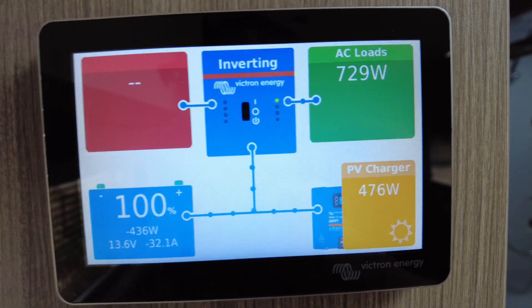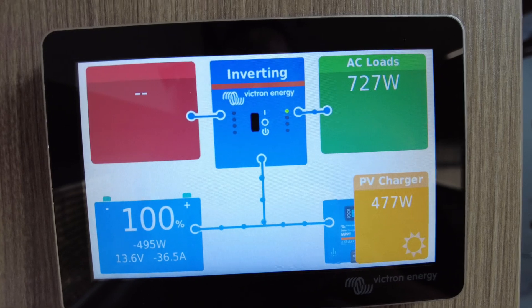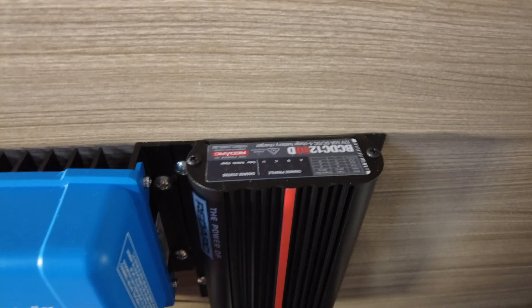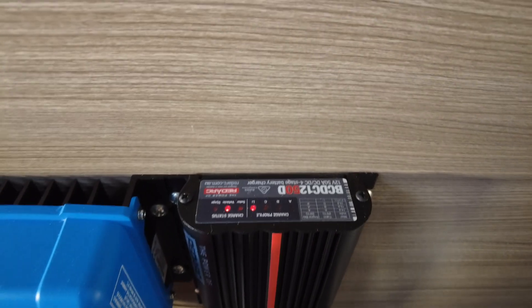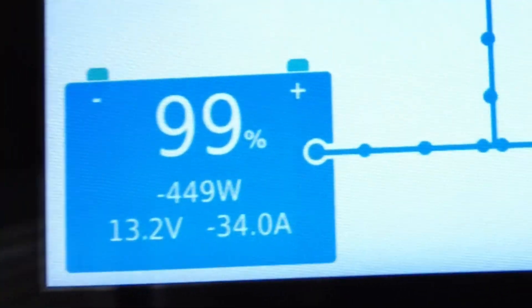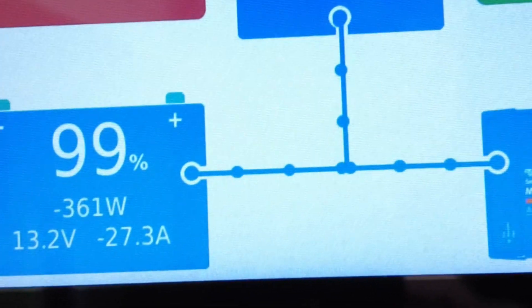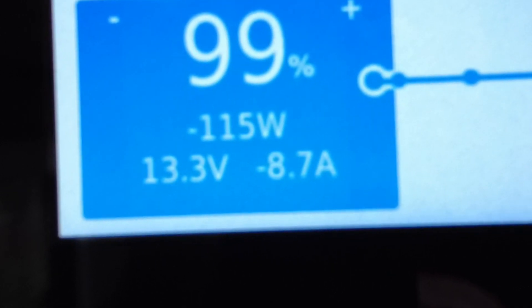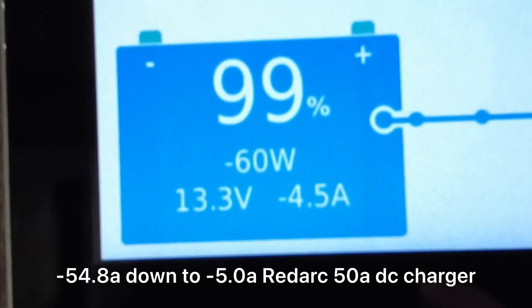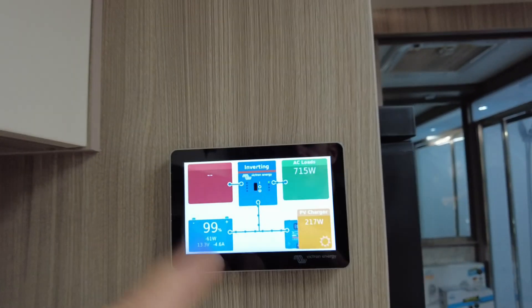The sun just popped out for a second. The gaps are so tiny — it's a horrible day for solar, but nonetheless we'll get this vehicle going. There's the engine running now. We'll go up to the screen and we'll see that 50 come in. Beautiful — it's ramping up. It's getting less and less. Down to 17 almost. There we go — that's the Redarc 50-amp DC charger. Solar's backed off slightly. There's that 50-amp DC charger doing its job.